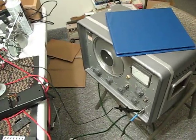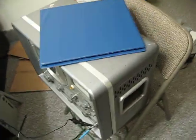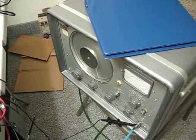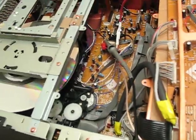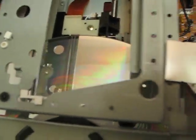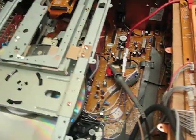That's a gnarly way to do laser disc alignment. Use this 50-pound tube-based oscillator. That's the way to do it properly. What's neat is you can actually hear it. I'm sure you probably can't hear it on the video, but you can actually hear it injecting the frequency right into the focus gain, so that you can hear the wee directly from the laser assembly when it's doing this alignment procedure, which is pretty neat. So that's doing alignment right there.